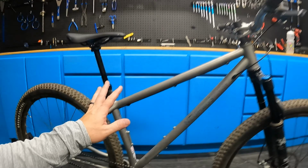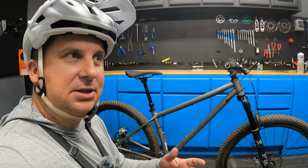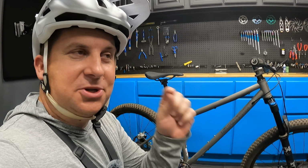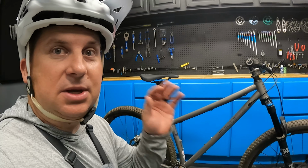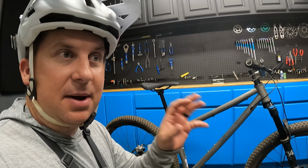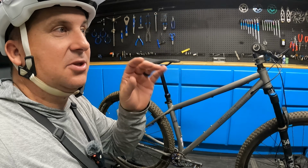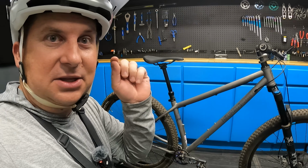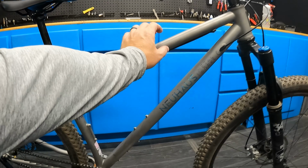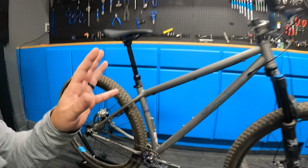Frame alone, the titanium frame weighs 1.8 pounds less than the steel one. Because titanium is technically stronger, you can go thinner on the tubing profile. So in the 90s, people went crazy. They're like, hey, we don't need aluminum or steel. We can get super thin with Ti and still have a light bike that holds together. Well, somewhat holds together. A lot of those old Ti frames cracked, but a lot of them would flex because they could get the tubing so thin it was still strong, but it had this inherent flexy property because they got the wall thickness so small. So Nick has calculated wall thickness and tubing diameter into every different one of his 16 sizes. The tubing's different between them.